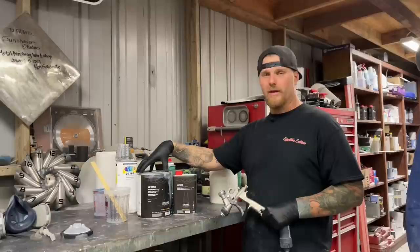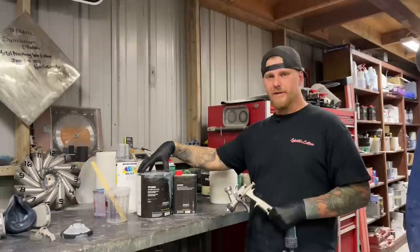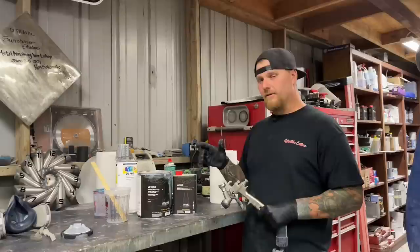Colton Davidson from Linear Blocks did a test on this stuff — he actually weighed it on a panel and it quit losing weight at three days. So even if you're in a crunch, obviously this isn't going to be your best bet for the collision industry, but when you're talking high-end restoration, this stuff is absolutely amazing. And you can block it way down just like you would a polyester.